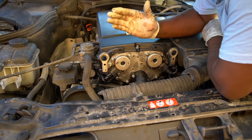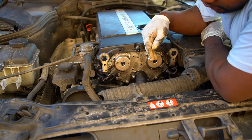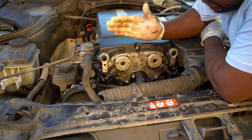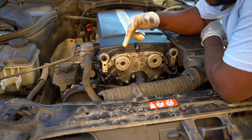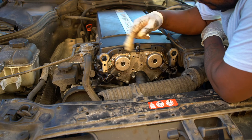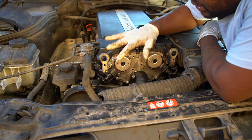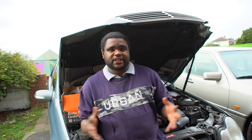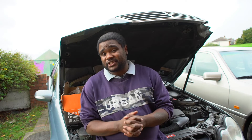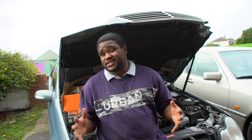I've cleaned up this place here and I'm going to leave it like this for a few days just to see if there's more oil leakages coming from these two here. I didn't clean it thoroughly — there's no need to go to town with it. This is enough to investigate what's really wrong with them. Hey guys, it's been a couple of weeks now. The evidence of oil leaking is there. Lucky enough, the new cam adjuster magnets are here, and today I'm going to show you how to replace them and finally solve this nasty oil problem.